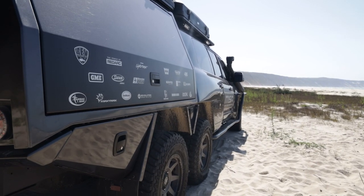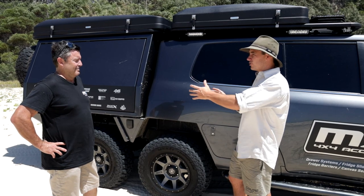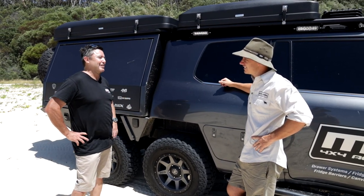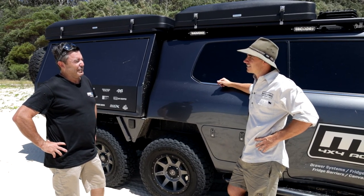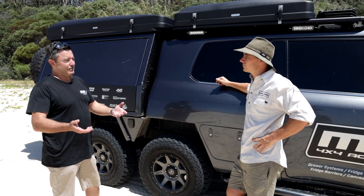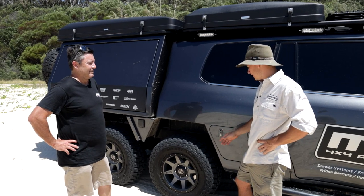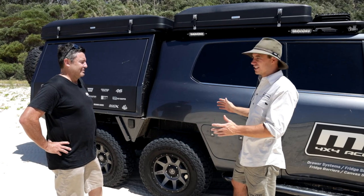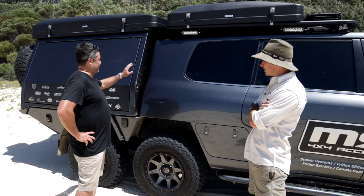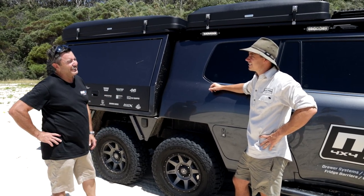Around the back — this is where the wow factor is. You've kept the back seats in. This is essentially a triple-cab, not the normal dual-cab conversion. The scary part was cutting the back off a brand-new VX with 11 k's on it. They sliced the back off, sliced the chassis, got the new Jmax system already assembled, slid it over the chassis, and grafted it all in. The lines on this thing are the most impressive part — with all those radiuses it looks absolutely factory.